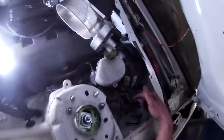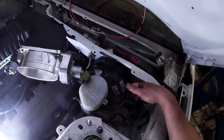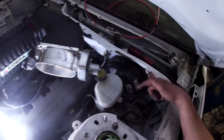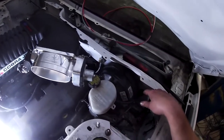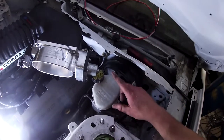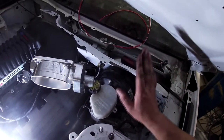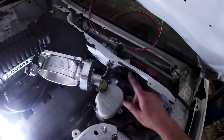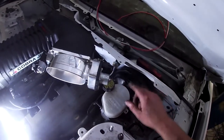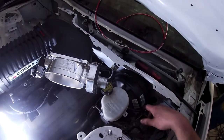The last thing you're going to do is bleed the clutch. Tilton has a pretty good procedure that comes with the clutch. Basically you're going to fill this up, crack the bleeder, and lightly rest your foot on the pedal just enough so it doesn't press the clutch. You work the hydraulic system by opening and shutting the bleeder — basically like you're bleeding your brakes.